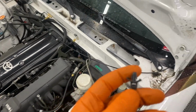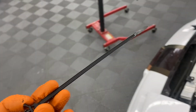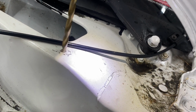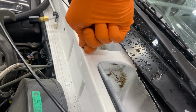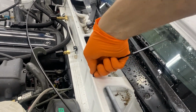My next thing I'm gonna do is, we have these cool zip ties, which are like a factory style. So you find a hole and pop them in, and then you can hold it down nice and tight and slim. So I'm gonna drill these weather stripping holes out bigger so I can mount there all across. What we got so far, got 2 holes drilled. They just pop in like that. And now they are one-time use, but should be good. I'm gonna run them that way.